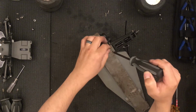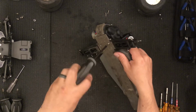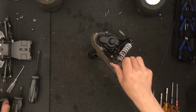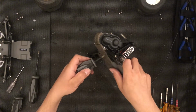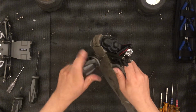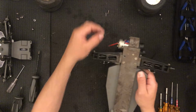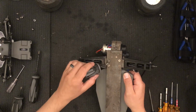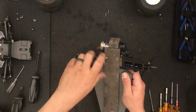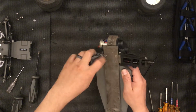I also get a sense about how worn the plastics are. Therefore, if I start threading a screw in, and let's just say it's a part that I've removed 20 billion times, obviously exaggerating. See, what I need is a short Phillips, but with a longer handle. And a diamond tip. But anyway, going back to the plastics, I can gauge also the resistance of the screw going in just to see how worn the plastics are, and to get an idea if I should consider just replacing the plastics, because everything wears out eventually. How soon? That depends on the use. Really depends on the use.